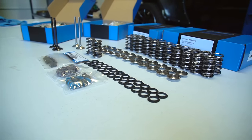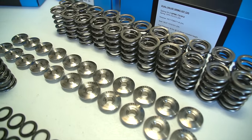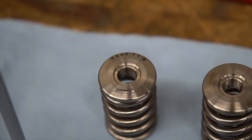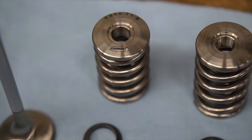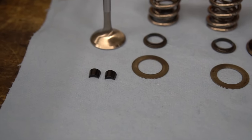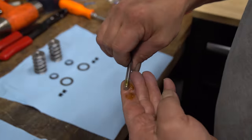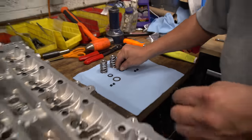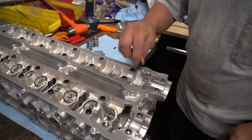Here's all of our Super Tech stuff — this is the valve train we're gonna install into the cylinder head. Dual valve springs, titanium retainers, CNC keepers, Inconel exhaust valves, and stainless steel intakes. Tom will go ahead and put some grease on the valves, then install the spring base locator — the spring locator keeps the spring centered. The dual valve spring is then installed, and down in there you can even see the valve seal. The valve stem seal is what stops the oil in the cylinder head from going down the stem of the valve and into the cylinders or the port.